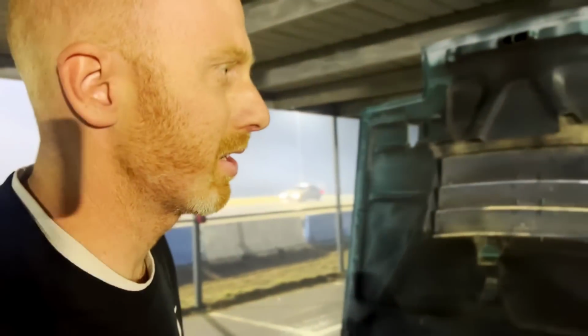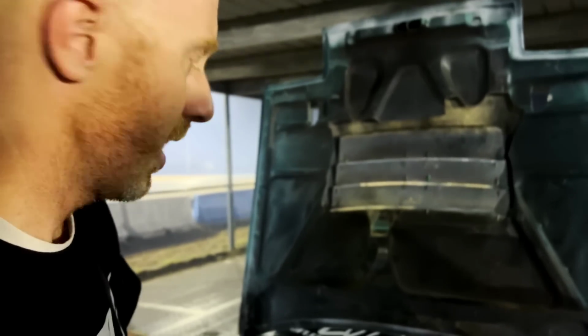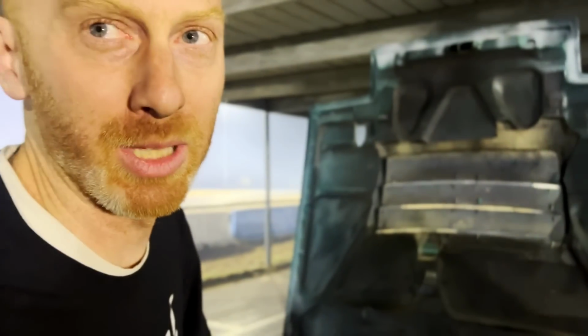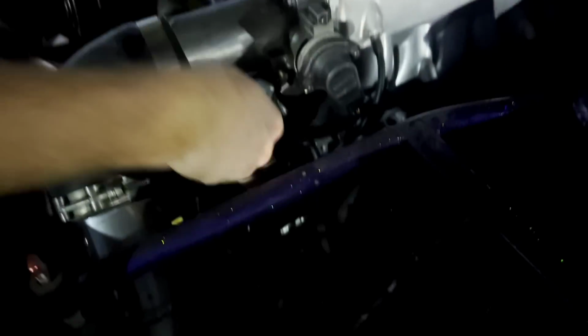In the pits, it was idling high. I didn't think anything of it because I haven't really driven it since we tuned it. But we went out that time and the AFRs were going crazy and it wasn't acting right. So we started thinking about it. The fuel pressure was fine, everything. So I figured probably a vacuum leak. Something popped off, because that explains a high idle and a weird air fuel ratio. Sure enough, one of the larger diameter vacuum lines, which makes more of a vacuum leak, popped out. And since I built the car, I know where it goes. I remember.